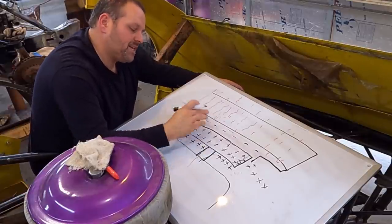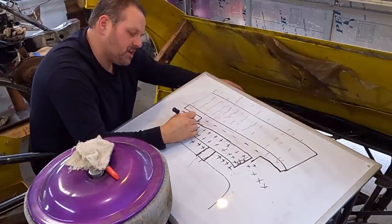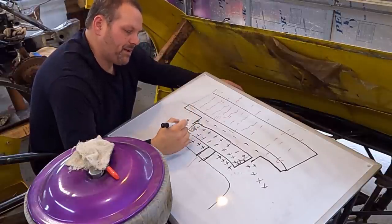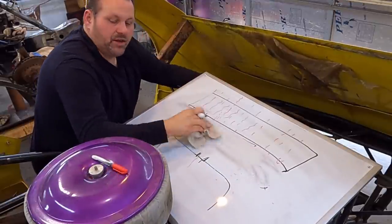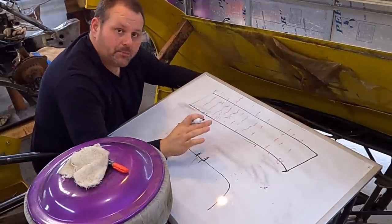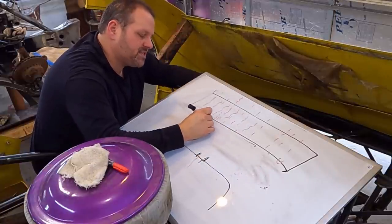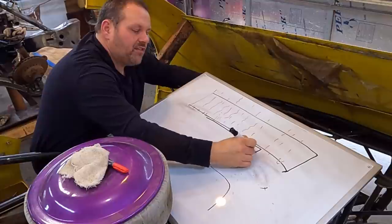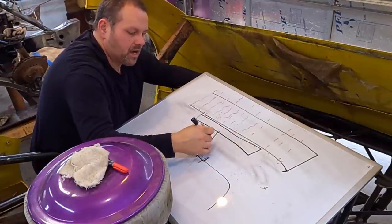But the fan blades themselves are rounded on the front corners. They don't come out to a perfect edge. And so for that reason, you want to be back. You don't want to be any deeper. So let's imagine that you're not running a fan shroud, but you say, I'm going to put the fan all the way up against the radiator. Let's be reasonable. You've got a half inch gap. I think that's about as close as anybody would be willing to go.